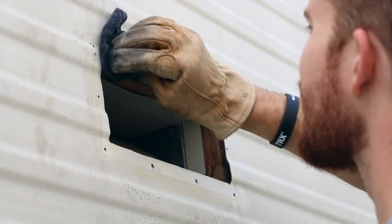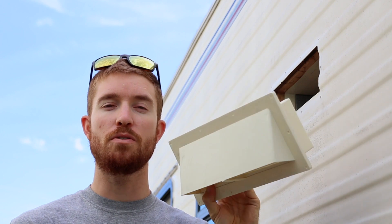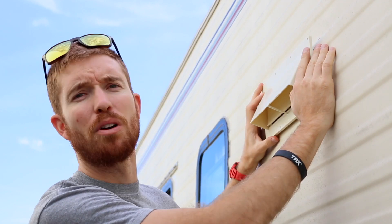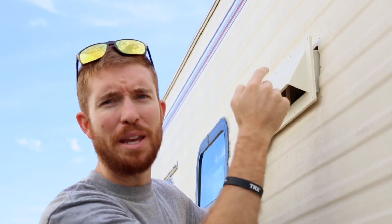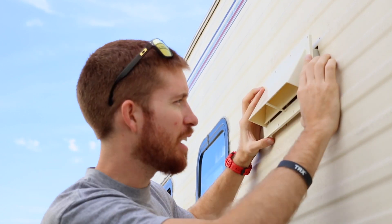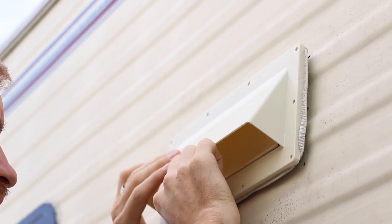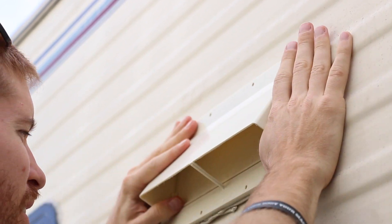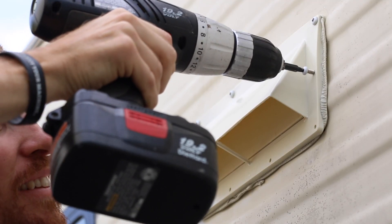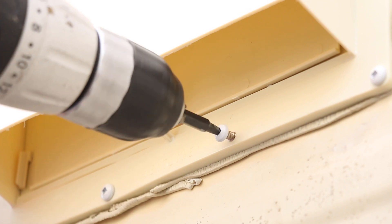Now that the area is clean and dry, I'm going to give this new vent a test to make sure all the holes are going to line up and it'll fit in our original hole. There is a little metal lip inside that's kind of preventing me from pushing it all the way in easily, but I can eyeball it and it looks like everything's going to line up just fine. We've got the butyl tape on — don't worry about the excess that bleeds over the top, that's going to get scraped away once it's fully screwed in. The tighter you screw it to the wall, the more butyl tape will bleed out, and it's supposed to do that.